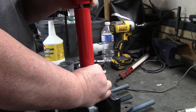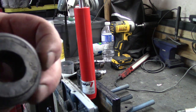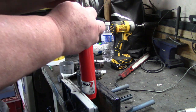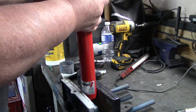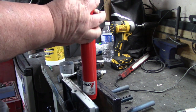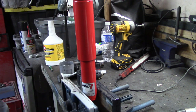Decision on settings: fronts went two clicks up toward firm, and we'll keep the rears at full soft. Now put the buffer back in - the concave side with the little chamfer on the edge goes at the top, flat spot to the bottom. Push it up into the tube, then put the split nylon washer back on and press it down to return the buffer all the way to the top.